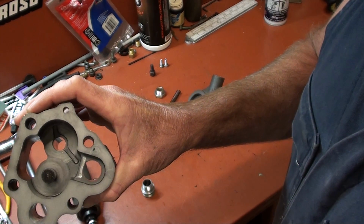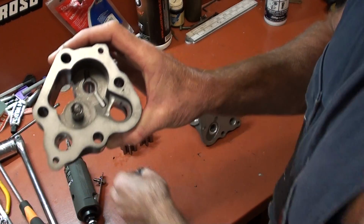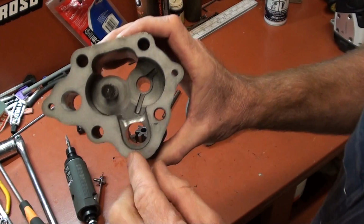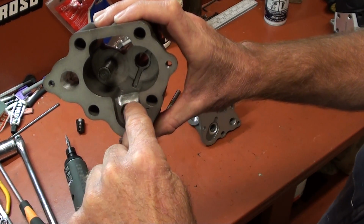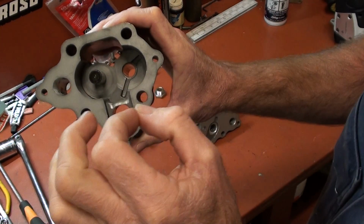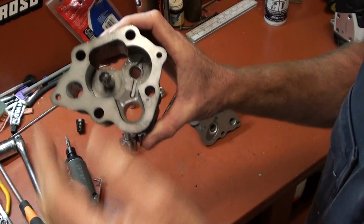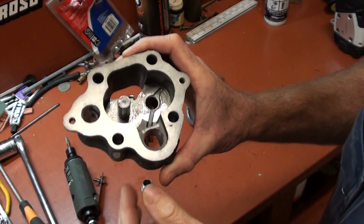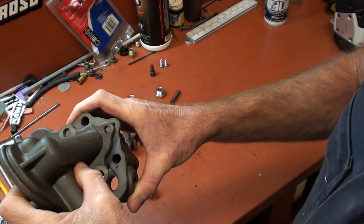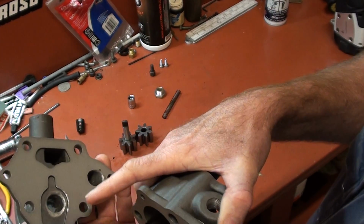So he recommends pulling that out and just putting in a 3/4 inch Welsh plug and getting rid of that. Now, he's told us how to blend it, so I've chamfered that over nicely, and that's the key, I think, to a good pump: to have all the orifices, the holes, everything mating nice with rounded corners for the oil to pass, and no real sharp edges. Now, once that's mated on here, as you can see, oil goes through here.